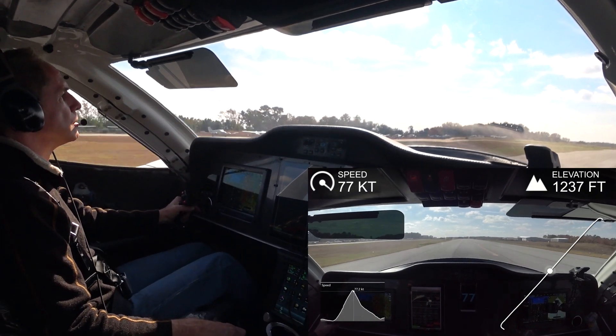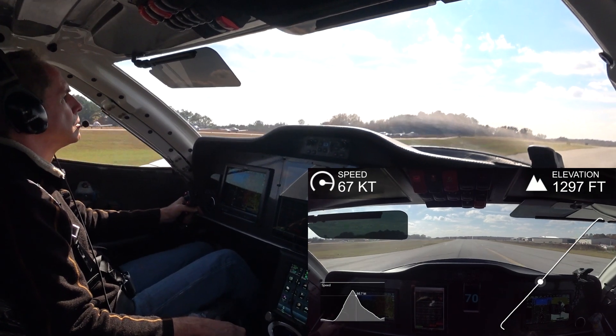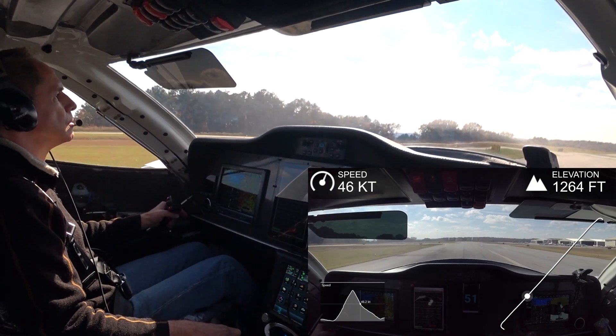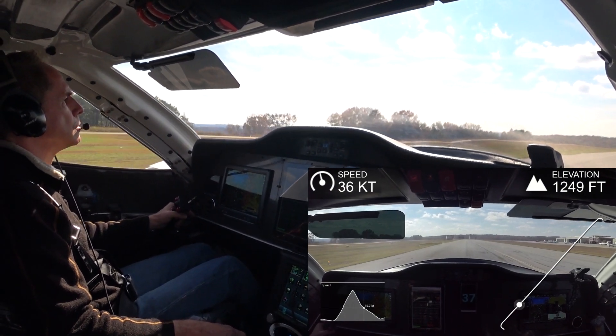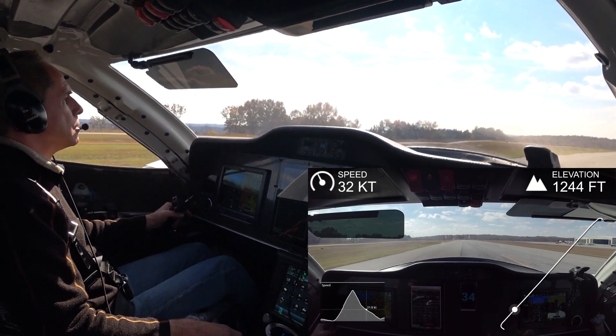The belts are running smooth as silk, and that was a lot more power being put down. In the previous run where it did those three blips, I had gone and changed the rev limiter about a week ago from 4000 down to 3800 RPM — so I think that's really what's going on. We'll have a look at the close-up video here in a minute.